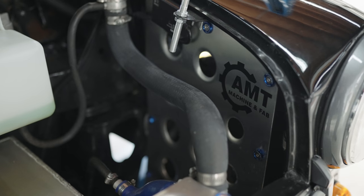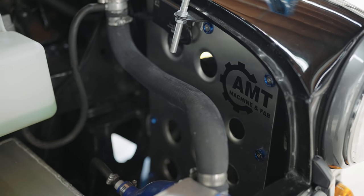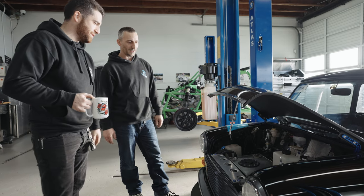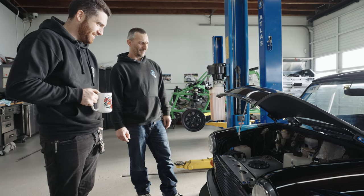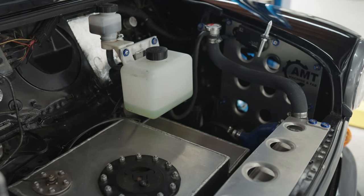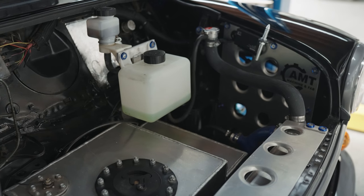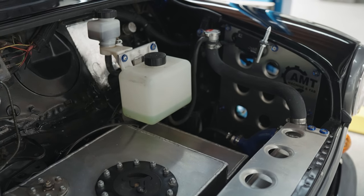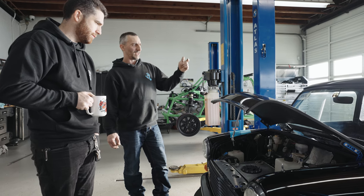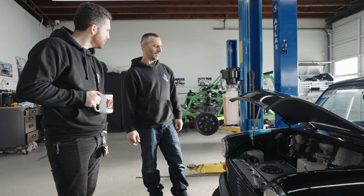The radiator was something that was quite big and cut in half — it fits really nicely. There's a Wilwood master cylinder for the clutch system. It used to be a cable-operated clutch on the bike, but the cable kept snapping, so everything was converted to a full hydraulic system, and it's been flawless.